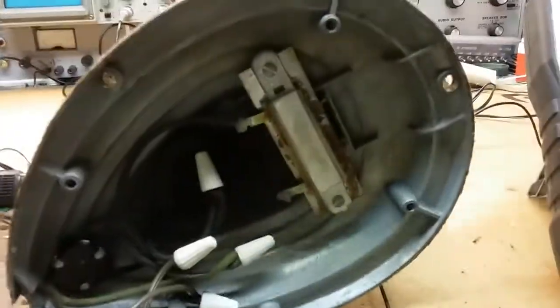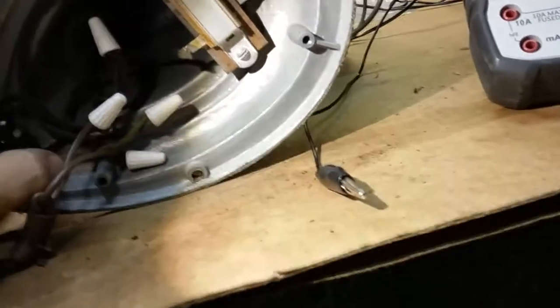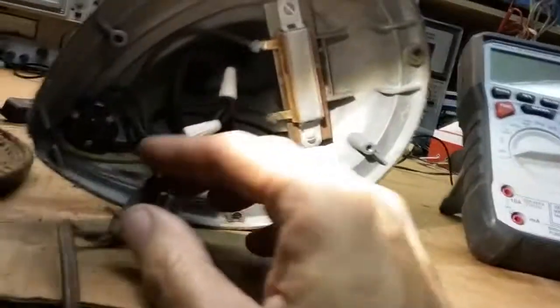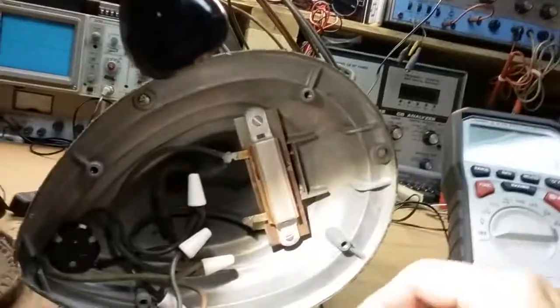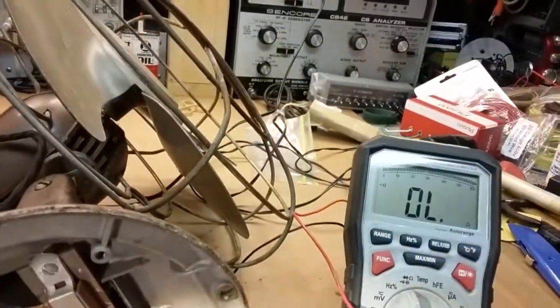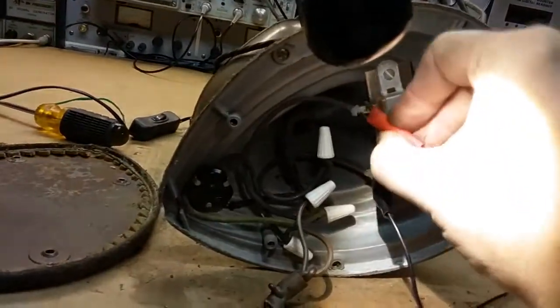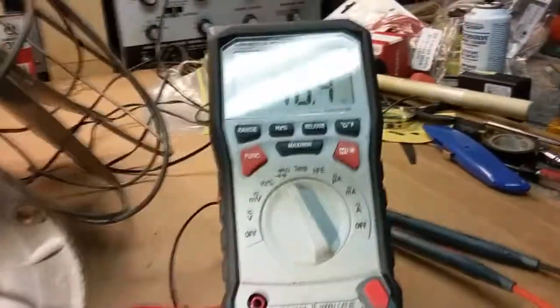Got the bottom off, and here's what I found. We do have a two-speed fan. The switch here is a three-way switch — a three-click switch — and it goes basically on high, connected directly to the fan motor. On low, it goes through this resistor, which I'm assuming is bad, and we're about to check. I've got my meter here and we will do continuity. You'll hear it when I touch that. The resistor seems like it's good.